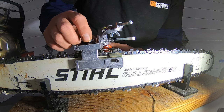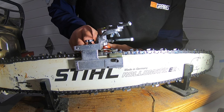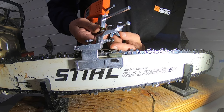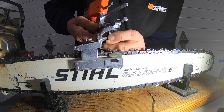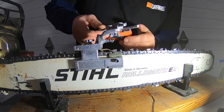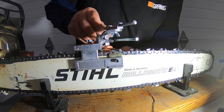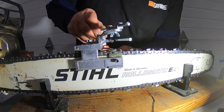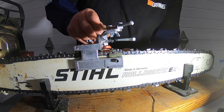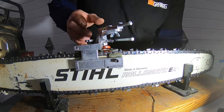I'll show you here — we're going up or down to make sure I'm inside the gullet. This is where the material stop is, right underneath this little black screw. I advance it clockwise until it just starts touching — about a half turn, five thousandths more. Now I can hear a little bit of grinding, and that's where we want to be. That sets my tooth length as far as how much material I want to remove. As you can see, we are right in the gullet and on the top — you know you're going to get a good grind. So now that we've made the three adjustments, all I need to do is turn it on and start grinding. The stone has gotten all the way to the gullet — it's nice and shiny — as well as all the way to the tip. That's cat's-claw sharp right there.